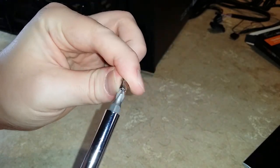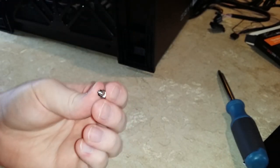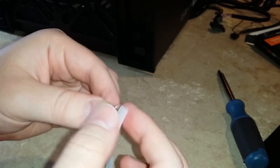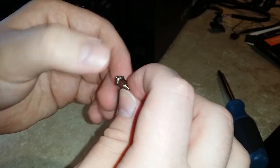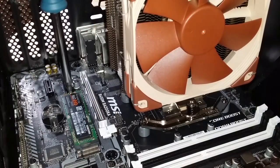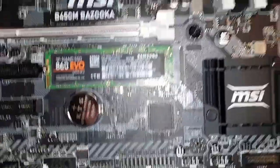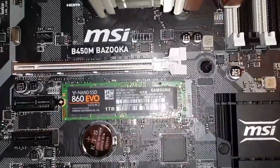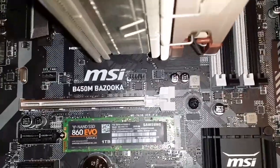It definitely fits with a Phillips head screwdriver. I thought it was just a kind of weird-looking thing, but I think there's actually a little place in there for another screw. So this is the standoff and the screw goes into it — and I bet the screw is that weird tiny little screw that came with the motherboard. Remember when I took that out and said, what the heck is this? It is. It threads into the center. That makes more sense. Look at that beautiful little thing. It's so small and so big and so fast — small in literal size, big in capacity, and damn fast.